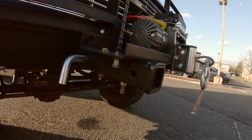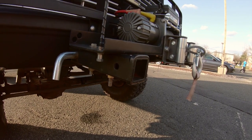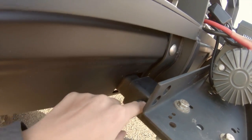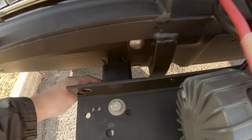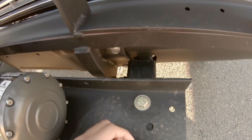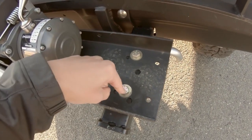Here we've got what I believe are 12-inch extensions for a hitch — you can get these at Harbor Freight pretty cheap. Essentially this hooks up right there to the base of the clevis, and you just drill a hole on the side and it lines up perfectly. You can actually see how it's kind of offset — it meets on the outer side on both sides. That took some careful measurements, but the benefit is it doesn't make any noises while you drive, doesn't rattle, doesn't even move. Then you drill a hole right down here...